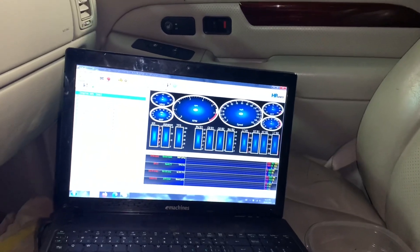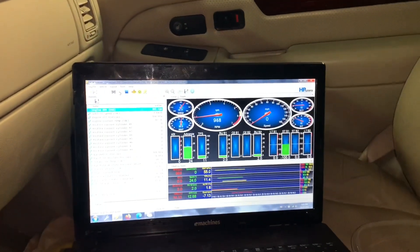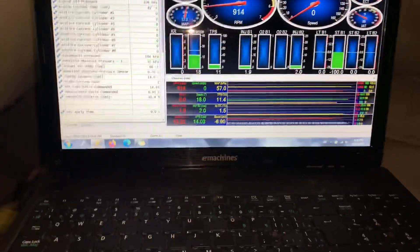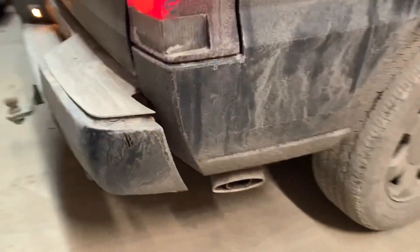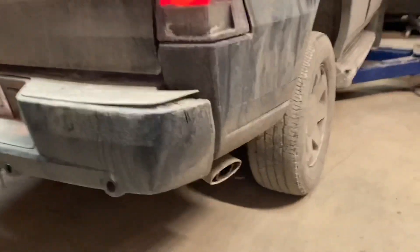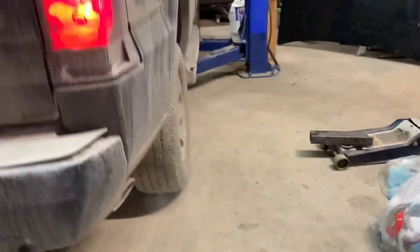It's all connected. We're idling lean — 15, 15.5, that kind of thing — so that's okay, not too bad for getting it running. Let's go see what the exhaust sounds like while we're waiting for this to gather some data. That sounds good — no trouble hearing that cam. It's not a big cam, but it does sound good.